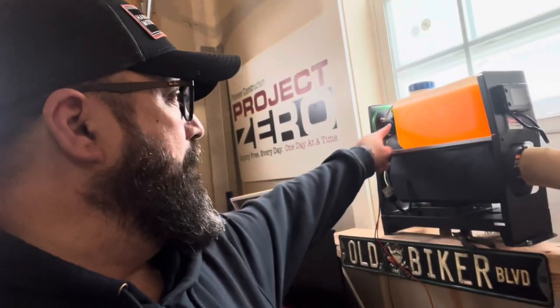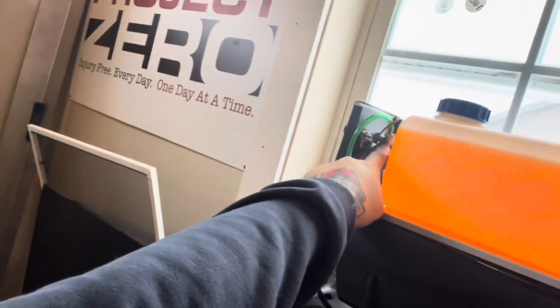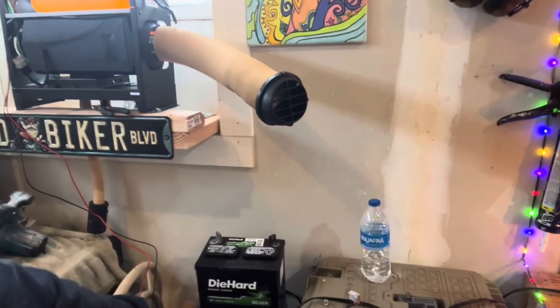Before we end the video — the diesel heater I installed last video. I wish there was something good I could say about it. For the 15 minutes it did work it was awesome, but there's a pump up here with a glow plug and a piston that pumps fuel down into the firing mechanism — and it just doesn't do it anymore. I also didn't realize they were all battery-powered; you have to hook it up to a battery, though there is an AC adapter modification available.